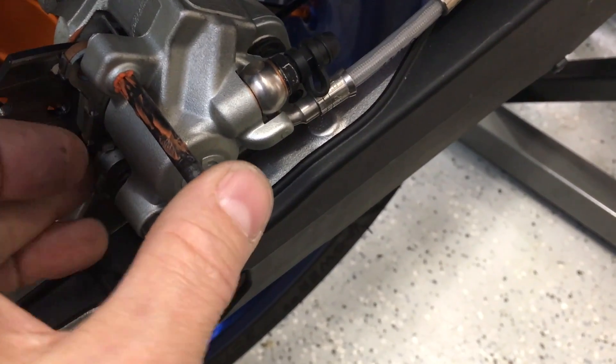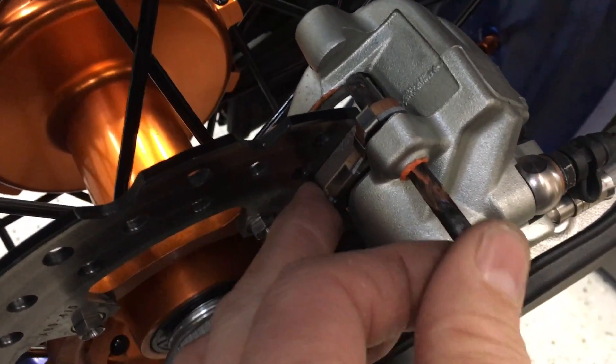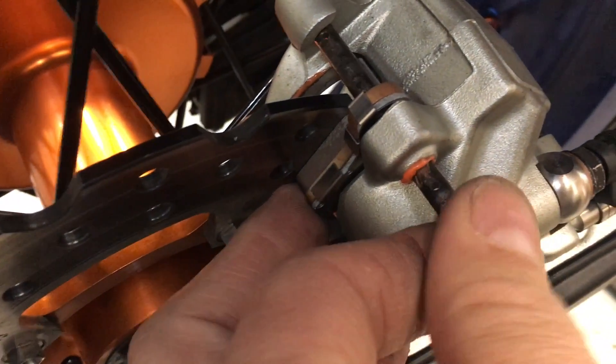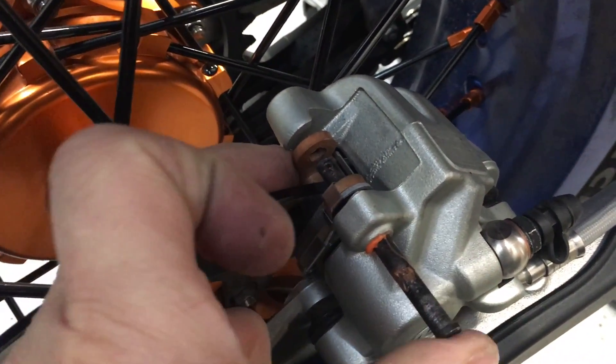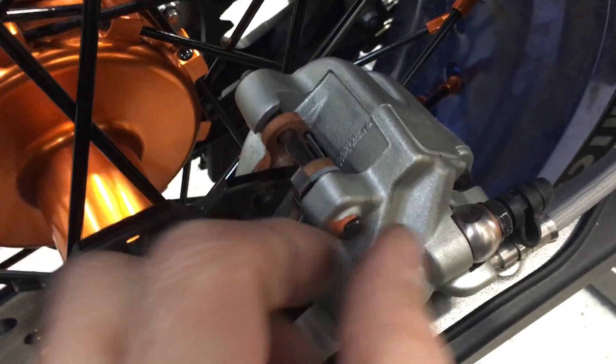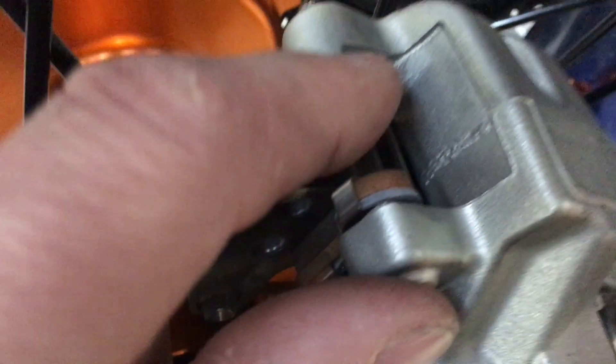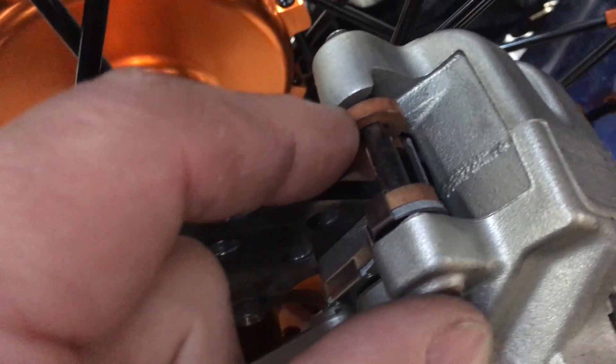This pin will go through — I'm doing this with one hand. Everything is lubricated now: backing plates are lubricated on both sides, my pin is lubricated. This could be another source of squealing — wherever you have surfaces that make contact with each other, there can be vibration and harmonics set up, and you get that irritating squeal. Just make sure your parts are clean and your caliper can move freely, back and forth.